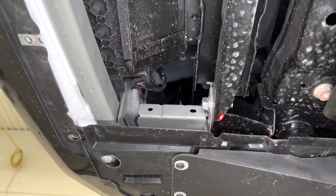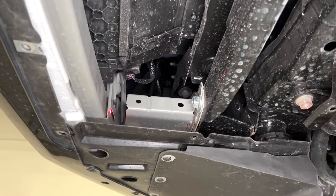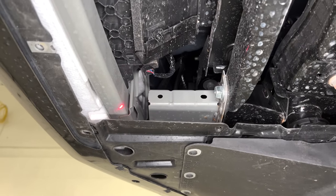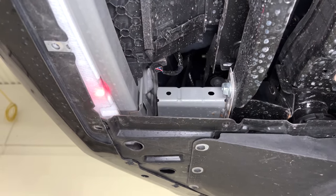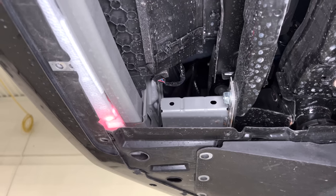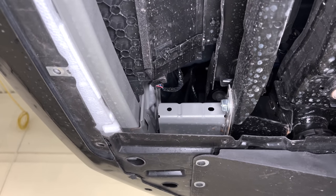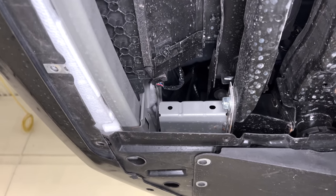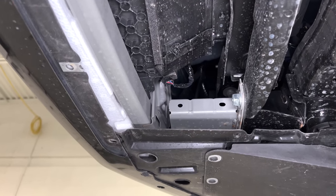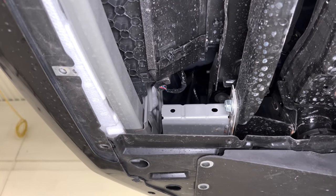And then you see this little fore-aft section right here going to it, but it doesn't make full contact with that beam. And so this beam, coupled with this white polystyrene, which is typically an expanded polypropylene, that sort of gray material right here, this whole section and these monuments are, from an energy absorption perspective, going to do two things on this vehicle, if I had to venture a guess. One, this monument right here, this section and this reinforcement are going to help from a SORB perspective.